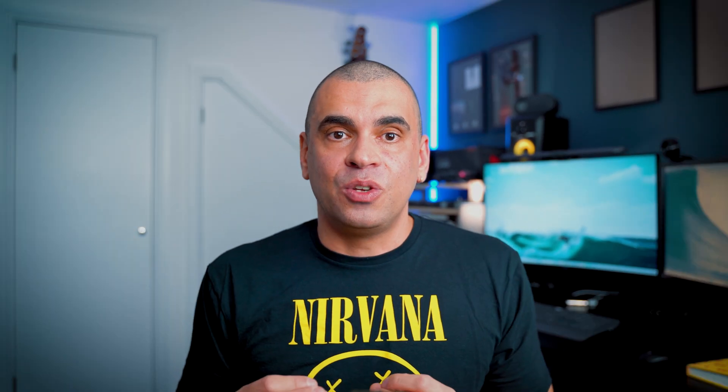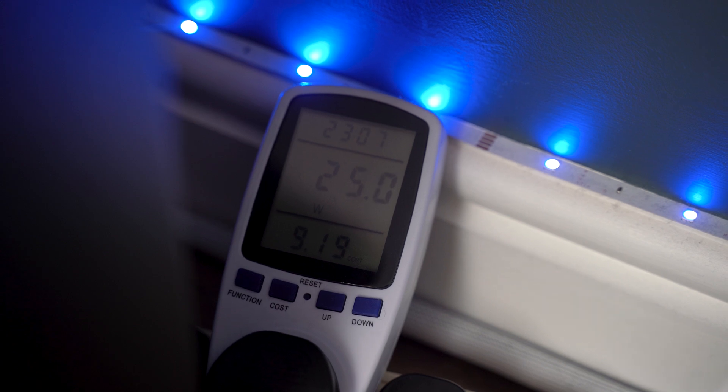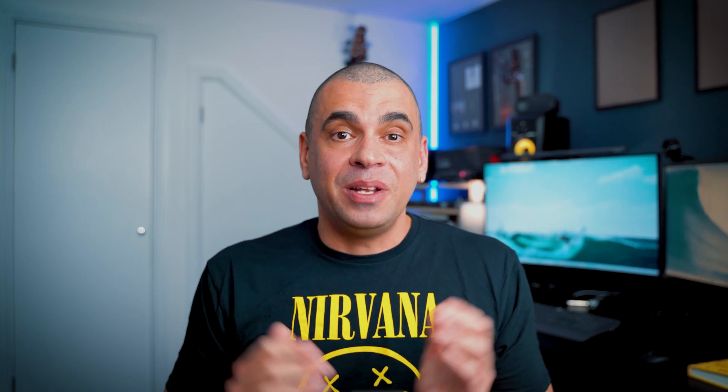Spinning down drives is quite crucial because it saves a lot of power. On full load with two disks during parity we're hitting about 35 watts, but with disks spun down we're looking at 22 to 24 watts. If you have more drives, energy consumption will also increase, so spin-down is quite important if you want to save electricity.